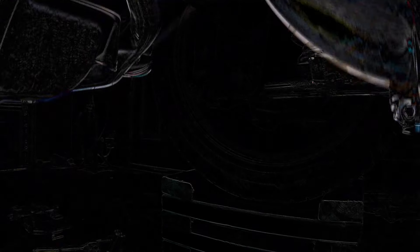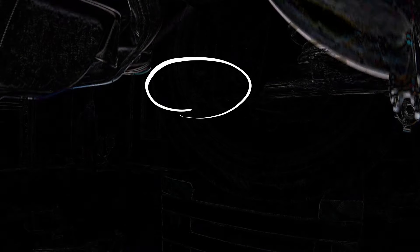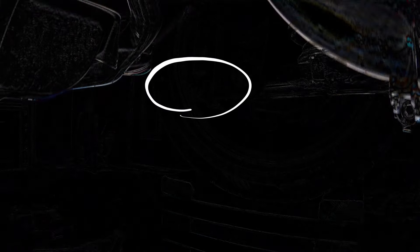Most of what you can see here is what's supposed to be moving — the suspension member moving, the gas tank moving up and down because it's attached to the body I'm rocking. You can also see the cribbing at the bottom moving, because this camera was mounted to the axle — the axle isn't moving relative to the camera, but the tire is compressing slightly so the ground and cribbing move relative to the axle. But if we play the video we can see one thing that's flashing and moving that's not supposed to: the shock absorber — the part I deliberately loosened. That part shouldn't be moving relative to the axle, and since we can see it moving, we know that's where we should focus our troubleshooting.